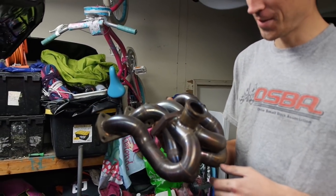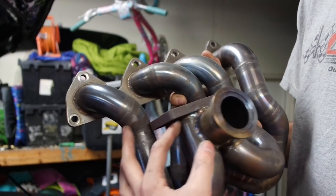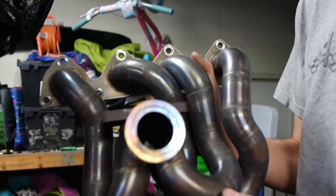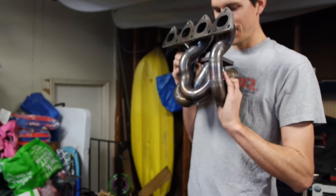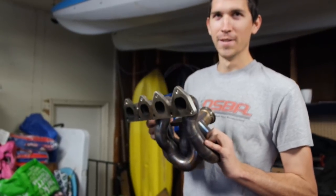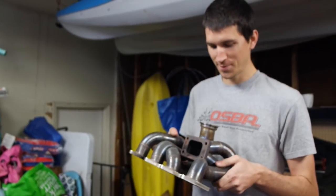So Mike's gonna explain why — since the collector here is so short, these back two runners will never get to flow to the front to the gate. So exhaust from those two are never coming out to the wastegate. That's why 18 pounds reveals itself. So do you think it can be fixed? Probably not — unless you got somebody who wants to run 18 pounds.